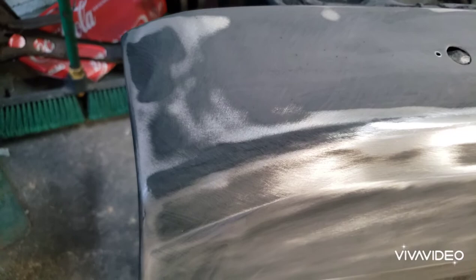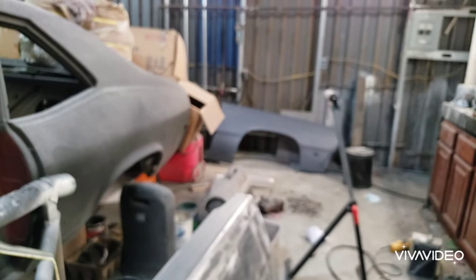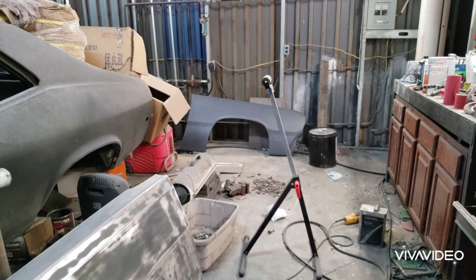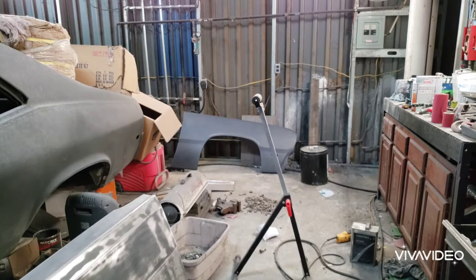I will say this: I used the white maker's epoxy on the other fender over there, and there were areas whenever I broke through to bare metal where it would actually start ripping loose if I used 80 grit. I was worried about it and it did cost me a lot of time and money. But I went ahead and took an 80-grit DA and took all the white epoxy off, then put three coats of HP 5311 on that last night.